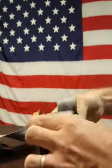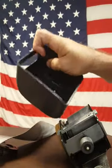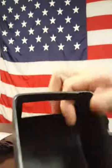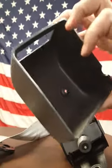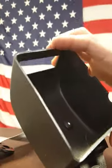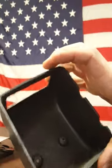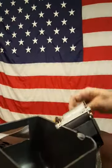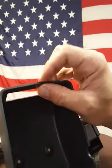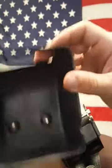My guess is the day that it locked in your car and sounded like it broke, it was probably because it got hung on this piece right here. And the reason that it used to feel like it locked up when you leaned forward is probably because you were extending the webbing all the way off the spool, and that is why it felt like it locked. So either the webbing's sew pattern was getting hung on this, or because right there is where it's almost fully extended.